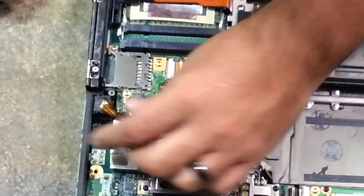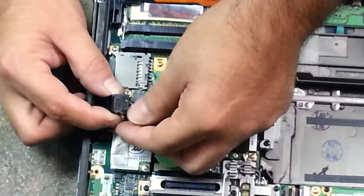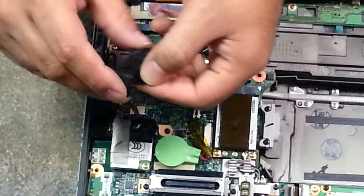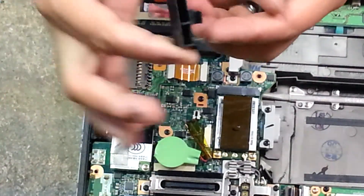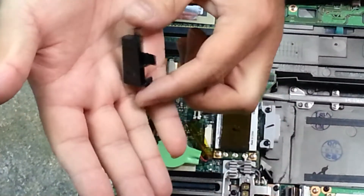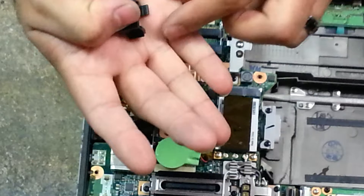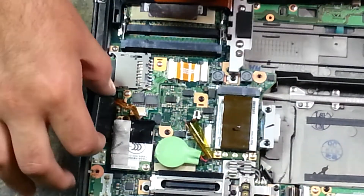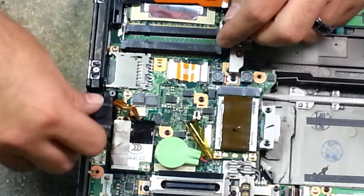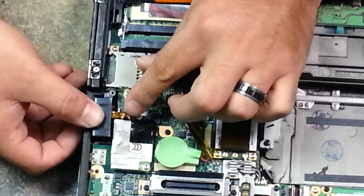Then you slide your board in. Notice here how this bundle of wires is on top of it — you've got to move them aside. Drop your ethernet in there. And this black cover that was on there has a little leg here. That little leg slides under the motherboard. You put it in at an angle, dropping that under the motherboard, and it will sit in there nicely. Then you just shove the bundle of wires into the slot there.